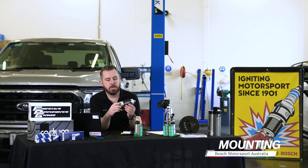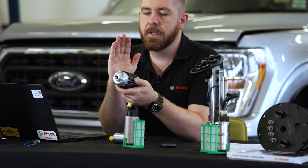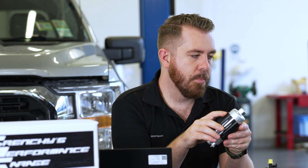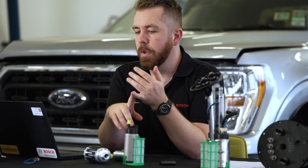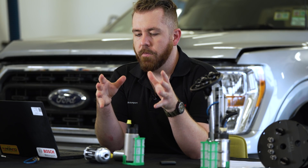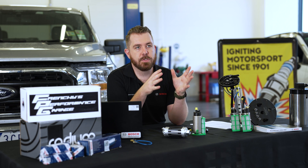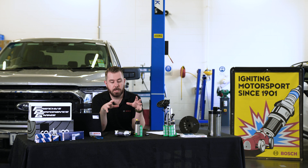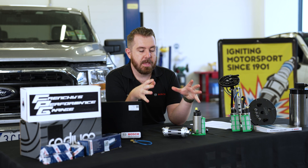You'll see here we've got a Radium twin hanger that fits the 46mm body of the BR540, and a few other examples including one from French's Performance Garage for the Skyline. So basically, for inline or in-tank, Bosch Motorsport has something that's going to fit any size of holder. You might have noticed the sleeve on the 200 pump, which makes it look a little different to the 044 — it's actually completely removable. It has two functions: first, it helps it fit into an existing bracket for an 044, and secondly, because it's slightly rubberised, it helps reduce vibrations. Reducing vibrations with your fuel pump mount is actually quite an important topic. Most fuel pumps in race cars aren't killed by poor quality fuel, voltage damage, or something getting through the filter — it's actually vibrations. Limiting vibration with a simple rubber sleeve or rubber isolation is really important to prevent shakes and bumps from coming through your chassis or engine into the fuel pump.